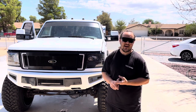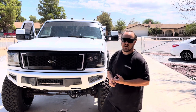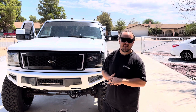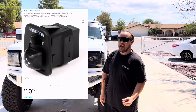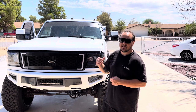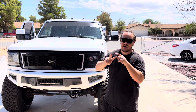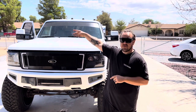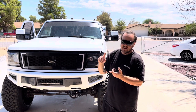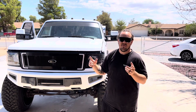I'm putting on a 99-plus mirror switch. I have a part number for that — it's like 15 bucks on Amazon. I have the wiring diagram that I'll plug in for you guys. It's really simple. It's two wires, hot and ground, and then you've got three to this mirror and three to this mirror. And then of course you have the clearance lights, however you want to hook those up.